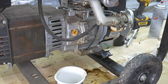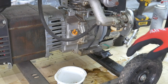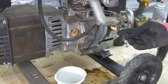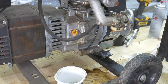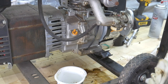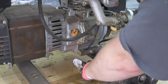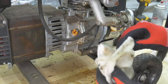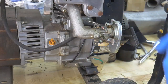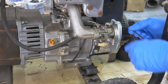I'm going to have to pull the carburetor off because the needle is not sliding — it's not moving up against the seat. So this job got a little bit more complicated. And the surface of my workbench does not like carb cleaner — I'm just finding out now. Apparently I was wearing the wrong type of gloves too because they started to dissolve with the carb cleaner. Probably should have known better.